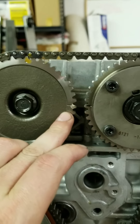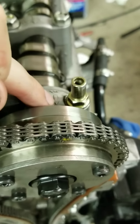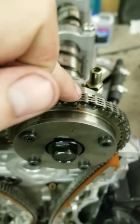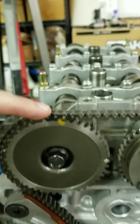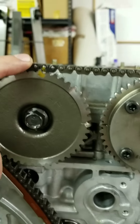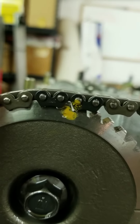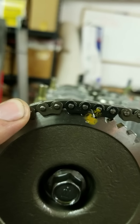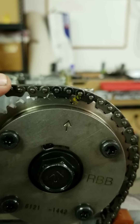If you come over to the cams, you'll see your timing marks are lined up horizontally with each other. Up on top you'll see the arrow for the first cylinder and the arrow that matches — this one's pointing straight up. Once those are aligned, you've got your timing chain, and if you look carefully you should see some black chain links versus the steel chain links. You'll also see two black chain links over here.